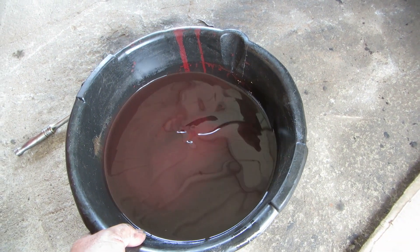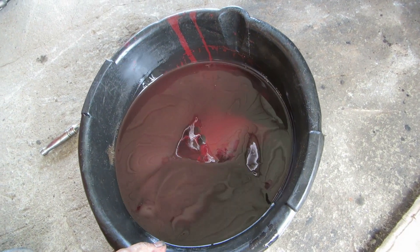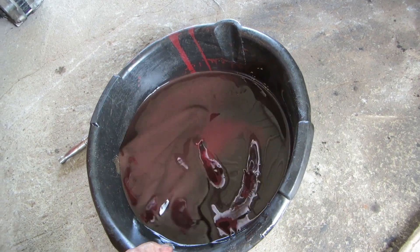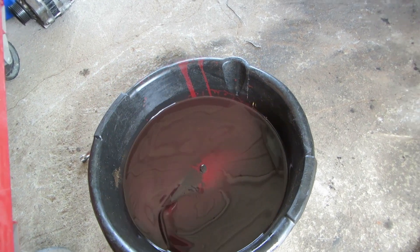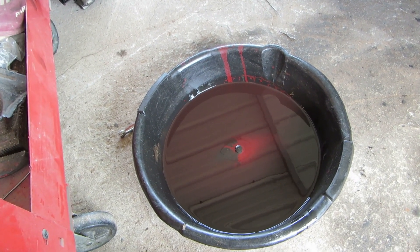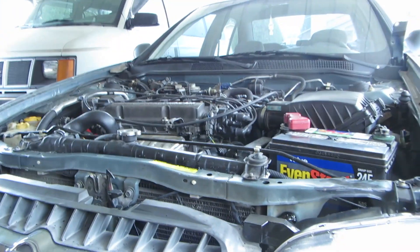This is a little questionable — it's kind of roily and not quite the color I'd want. This is transmission fluid and I had too much in the transmission, so I had to let out a quart, and when I let out a quart, this came out of it. Probably I'm going to want to drive it for a week or two or a month and then do a flush on it. It only took seven quarts and the whole system holds 12, so there's five quarts of old fluid in it. Put the hood on it and we'll go.